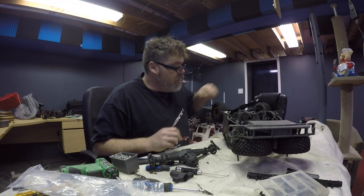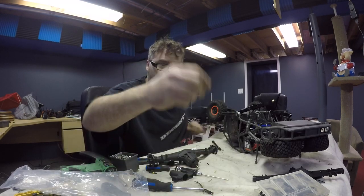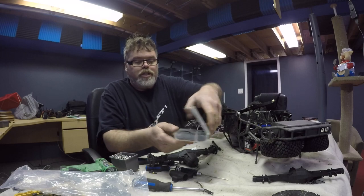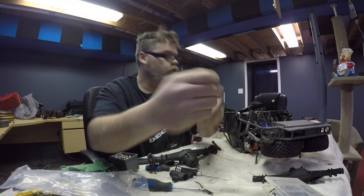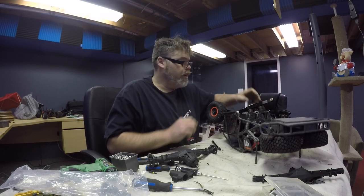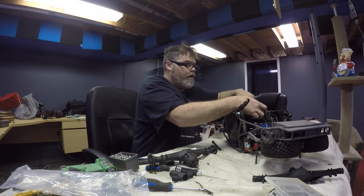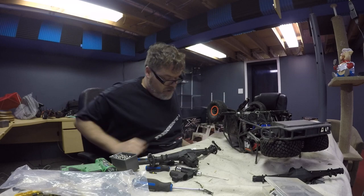The thing in between the output shaft we're showing you here is just a rubber bushing. So what I did is I went out and got my trusty old tap repair kit. I took a little ring and drilled the hole out bigger, and it slides right over it, boys. That's all you have to do. It's just a bumper. When it bottoms out, it doesn't bottom out against the transmission. There's a bump there. So that was an easy fix.